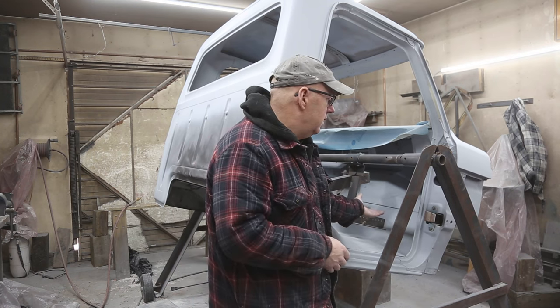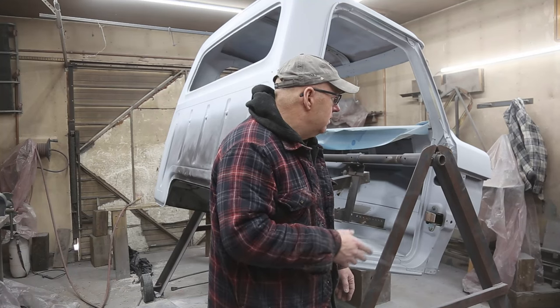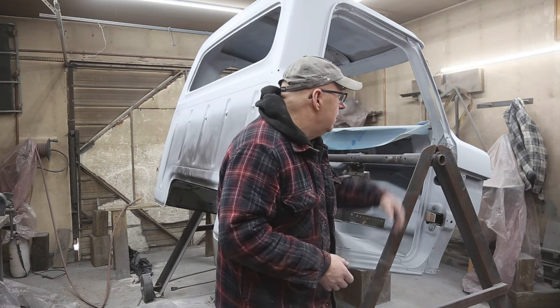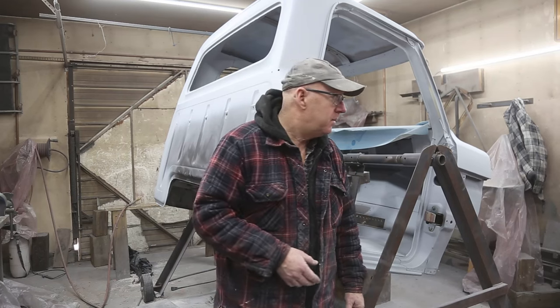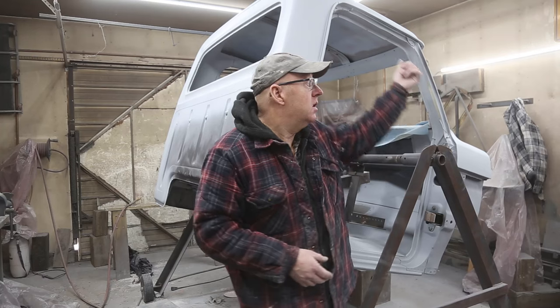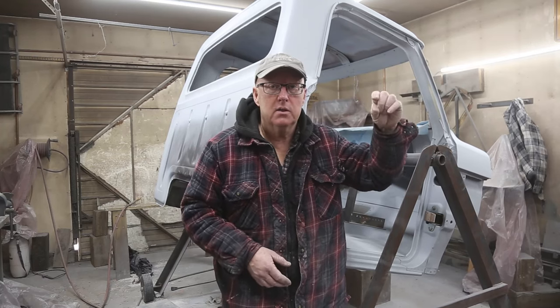We're going to get going on prep, and I think what we'll do is probably keep on prepping. We'll get started on the caulking, all this stuff in here that needs to be caulked. There's a lot on this truck. And yeah, probably going to need maybe 2.5 tubes. Because when you start doing this, the drip rail there is really, really deep on these Fords. So we're going to have to do it in a couple layers. Anyway, enough talk, let's get started.